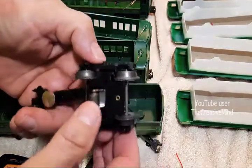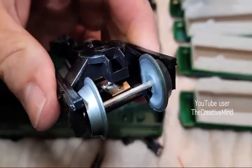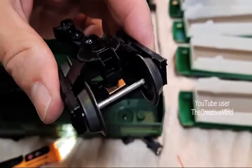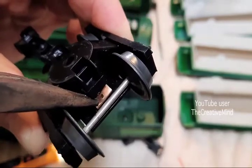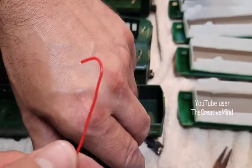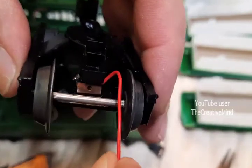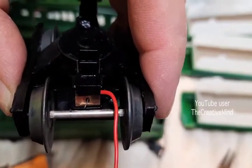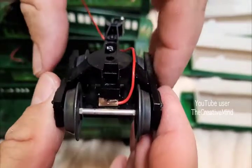As for the center rail truck, the place we're going to solder onto is the hole right there on the pickup. It's folded over so it's going to be kind of hard to get to that clip. Just pry it out just a little bit — that's perfect. Strip some of the wire back, make a little hook like you see here, then get the wire inserted through the back of the copper contact. You want it to go through the hole just like this, then push the wire over the copper, wrap the rest around the coupling, and it'll hold in place ready to solder.